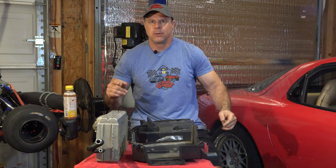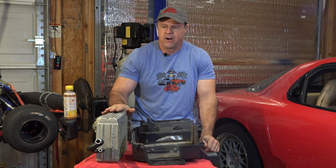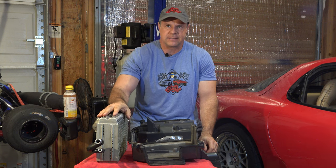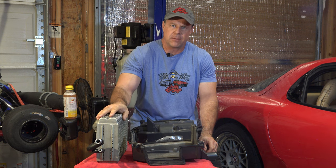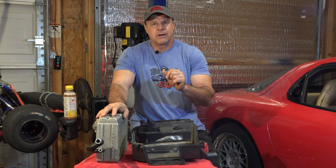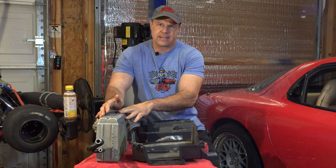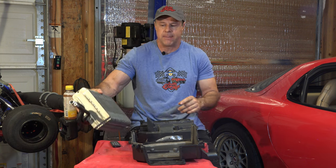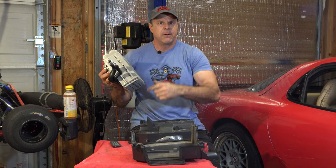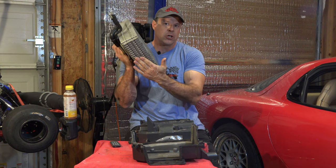Here's why — I'll go back to a little bit of science. In space you can achieve a vacuum of around 24 pounds per square inch; at sea level here in Houston, maybe 17. I know you can probably go on the internet and prove these numbers a little wrong, but I'm somewhere close. The bottom line is you can't achieve a perfect vacuum, so that means moisture is in your system regardless — you just can't get it all out. When cars sit, that moisture reacts with the oils — the 134 oil — and creates sulfuric acid. When you let these cars sit for years and years, it doesn't really matter when you drive them because it's circulating, but if they sit, that sulfuric acid sits at the bottom of your evaporator, and this is what usually goes bad.